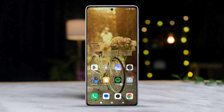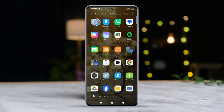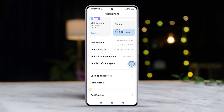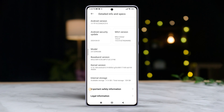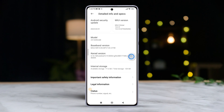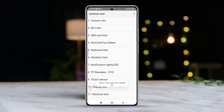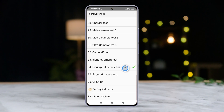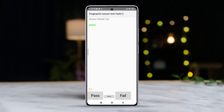Solution 1: Check for hardware issue. Open the Settings app and tap on About Phone. Next, select Detailed Info and Specs. Scroll down and find Kernel Version. Tap on it repeatedly until you enter CIT or hardware test mode. Scroll down and tap on Fingerprint Sensor Check. Check if it says 'Pass' and try the fingerprint input test. If it doesn't work, consider sending your device to the Xiaomi service center for repair after trying out these solutions.